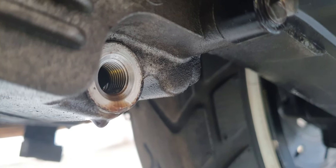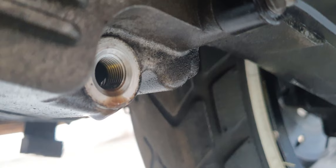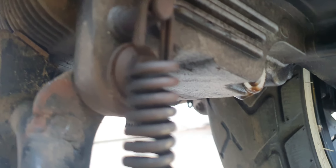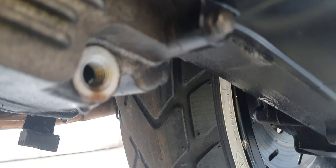I think a lot of people may not know this. If you were just doing an oil change and not changing the filter, you could use this one alone, but if you are changing the filter, you obviously need to remove that housing too. You will get extra oil draining out when you remove this side as well, so I think that's important for anyone doing an oil change.